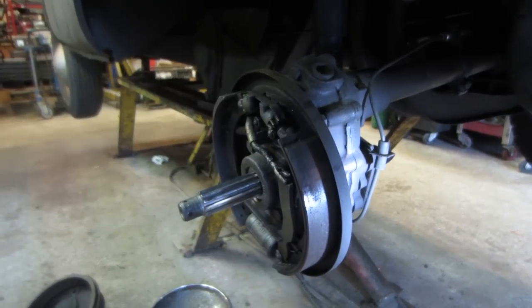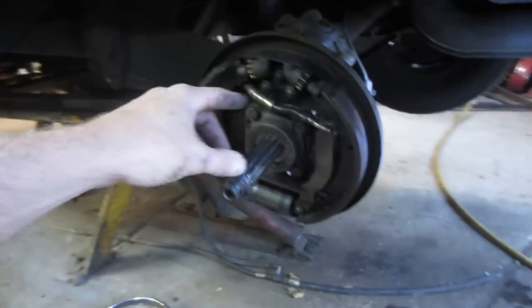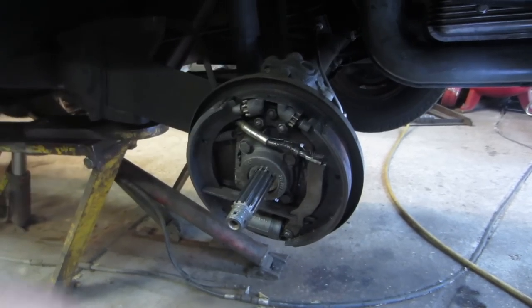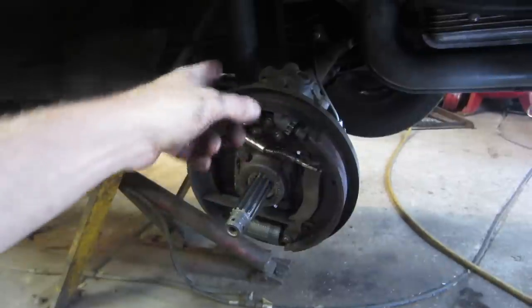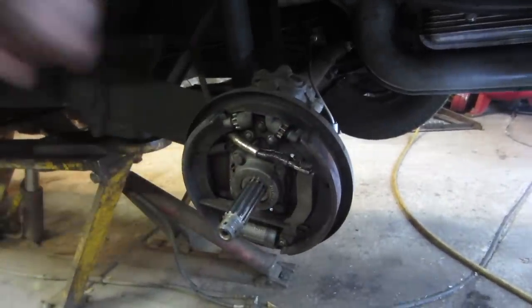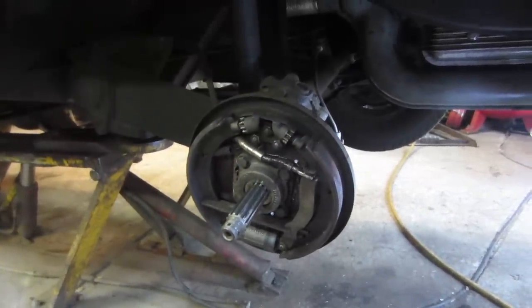but I just want to give you an idea what is inside here and what is happening. So I'm gonna go get the brake shoes off, disconnect the brake line, get the backing plate out of the way, which is gonna be these four screws and the emergency brake, and that will get us into that assembly, but we have to dig in much further yet.